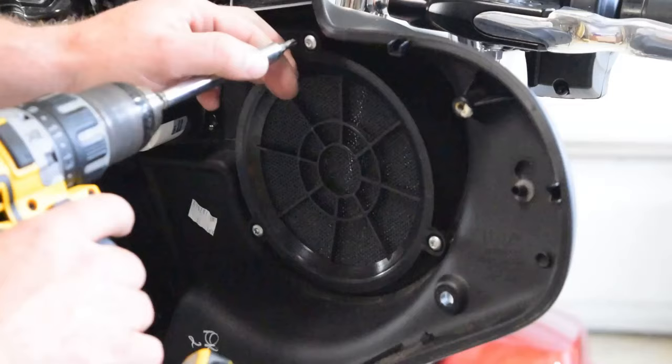I ended up using a wire off this harness, this plug right here, for my switched 12 volt turn-on wire. I was unable to find a switched 12 volt source in this harness right here for the radio. I'm not sure why, but I couldn't. And this plug right here is not used at all. So I probed the pins until I found a switched 12 volt source, and then I just threw a T-tap on there. And there it is, I've tested it, it works.